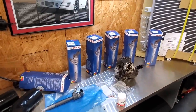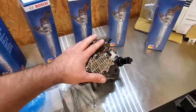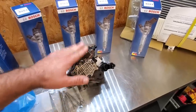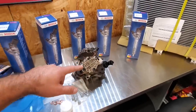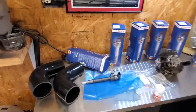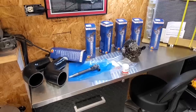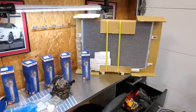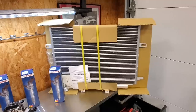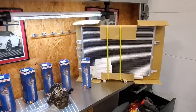I will be sending these out to Rochester now to have them honed out. If you guys have a car that's blowing some black smoke, maybe it's down on power or having a hard time starting — after you look at the glow plugs, the injectors are basically your next step. They do not last forever at this mileage and will start to leak internally depending on what type of diesel fuel you're running. We also have a bigger high pressure injection pump out of something like an E400, the V8 turbo diesel in Europe. We're going to be installing that in this video, along with new charge pipes and a new condenser.